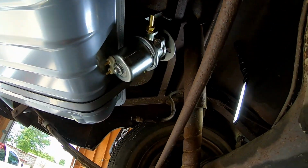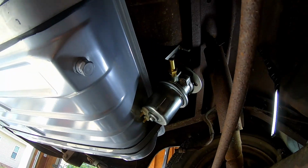We'll run to the store and get some parts, and then we'll button up this part of the fuel system install. All right, so here we have some 5/16 brake line. I thought it was 3/8, it's actually 5/16, but we got some line. So we're going to bend the line from the tank to the pump first, and I'll show you how we're gonna do that. And then we're gonna come up front and figure out how we're gonna plumb the front of the fuel system.